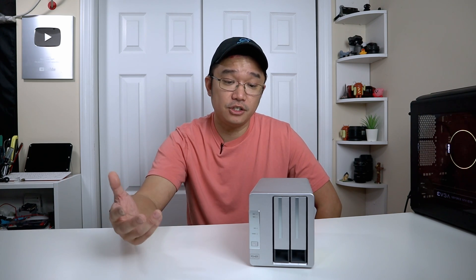In conclusion, if you're looking to get started with your first NAS or a two-bay NAS, this is pretty good. It has a solid CPU setup and the price is definitely decent for what you're getting. The sheer amount of stuff you can run off this — because it does support virtualization and Docker — means you're going to get a lot out of it if you utilize those utilities. One thing I do not recommend: TerraMaster has their ARM version, and I ran one of their ARM versions before — it's a world of difference between ARM and x86. They put more time into developing x86 versus ARM. So make sure you are getting the x64 version versus ARM. I know it's a big price difference, but it is worth the extra bucks.